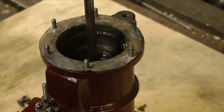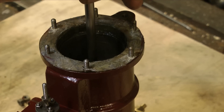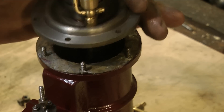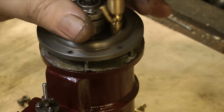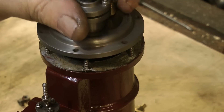Then all you have to do is just run round the edge with the knife — first round to the gap at one side, then round to the gap at the other side — and as if by magic, the piston will slide into the cylinder. You do of course have to repeat this for the second ring, and remember that the gap is at the other side. It is slightly more difficult because you can't tilt the piston quite as much as you could when the piston was nearly all the way out of the cylinder.